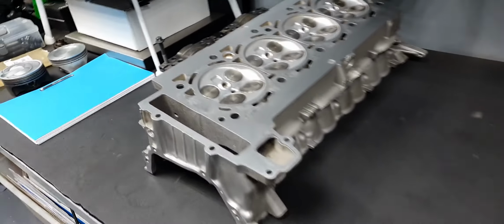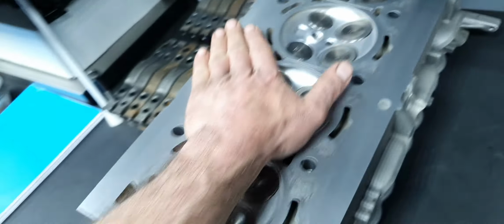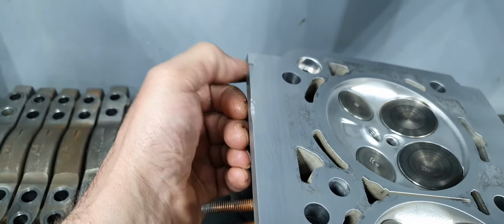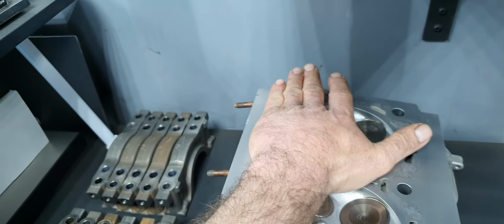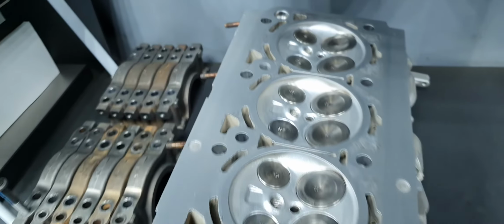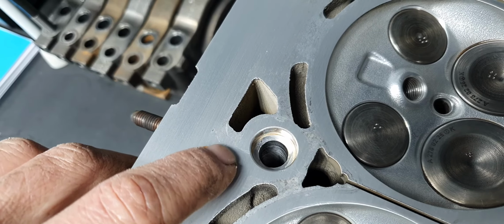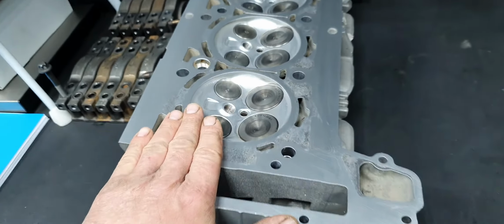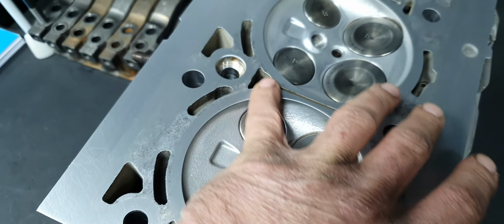Okay, here I have the cylinder head. I already cleaned it. I removed the carbon. The surface looks beautiful. There is only one mark here that I saw. It's not caused by me, but this is outside. That means it's not stepping at all on the block. The block steps up to there, and is staying out. It looks like there is a sign. When they tried to insert inside, most probably they scratched this a little bit. But again, there is no problem here. There is no problem on the coolant path to indicate that something is inside.